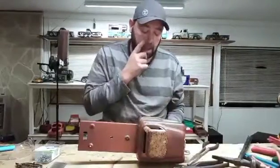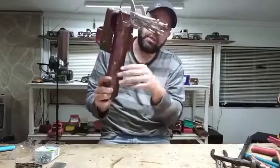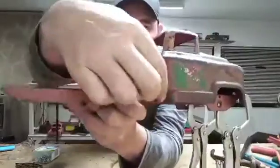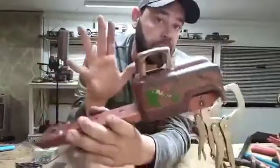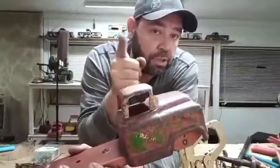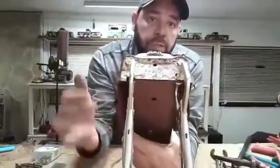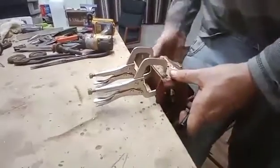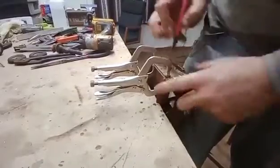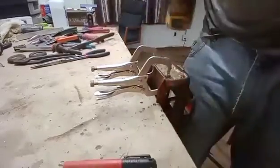There's one more part to this and it's really simple. I've got my back strapped down with my tabs bent over so it's holding on to the frame. I tried to level it up and get the bottom of my cab lined up level with the bottom of my frame, because of the bed I'm going to make for it — that's Friday night's episode, so tune in Friday night at seven o'clock. I've got it clamped down in the front and I'm just going to run a couple of pop rivets in there. I'm going to hold my truck in place with my hip, mark my two little holes, and take my one-eighth drill bit with one-eighth rivets.